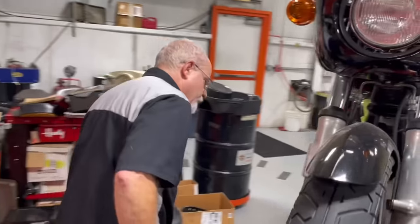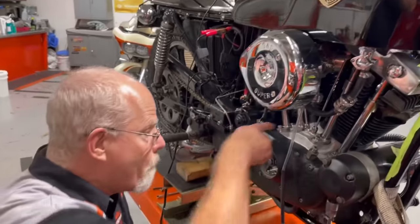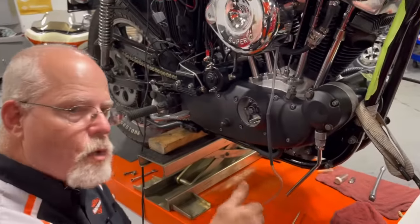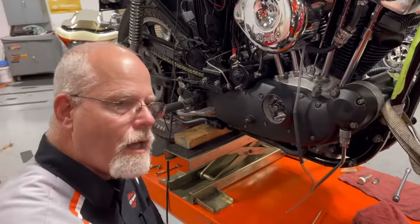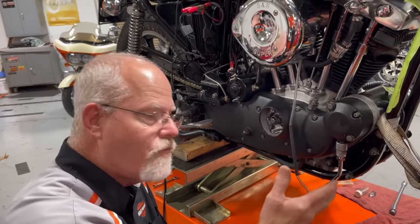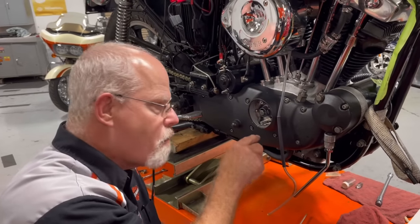So how do I check it statically? Let's go to the other side. For you guys who have some Sportsters, you would have a timing hole right there in the middle on an Evolution, but on a Sportster this year it's on that side. Big motors, it's on that other side. But some Sportster owners will have it right here, and that's convenient because this is where the timing is adjusted on this model.